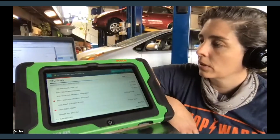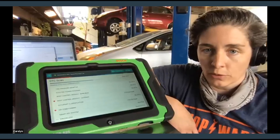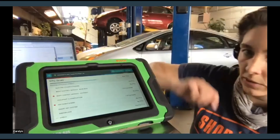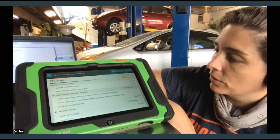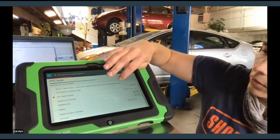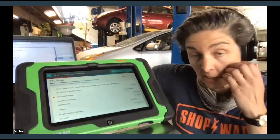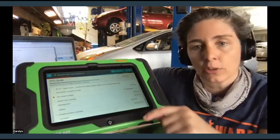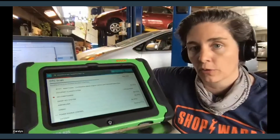Normally you'd be checking the oil, filling the tires, doing whatever else you need to be doing while this is running. You can actually start to see the DTCs as they're generating as the scan runs. I've got some LAN and combo meter codes, air conditioning — this car has, I think, 17 ECUs, so we've just got two more to go. When the scan completes, a few seconds after the last ECU is processed, you'll see down here a little bubble that's going to say 'Upload Complete' — that's when you know this is going to show up on the RO.